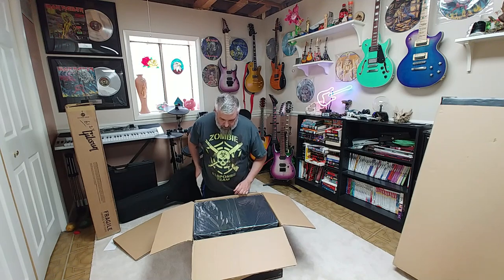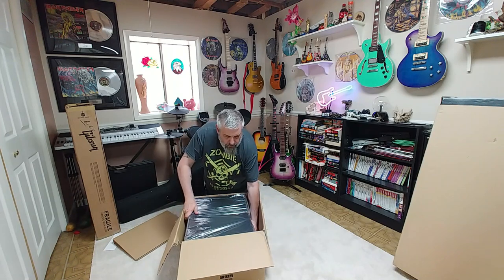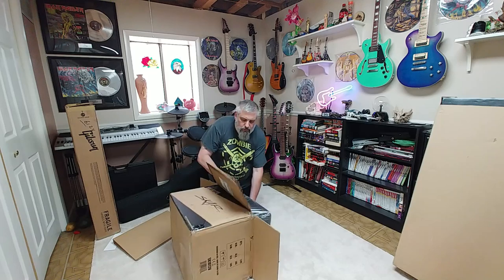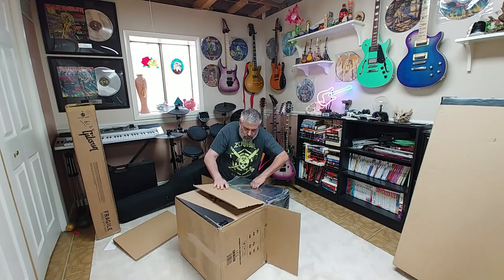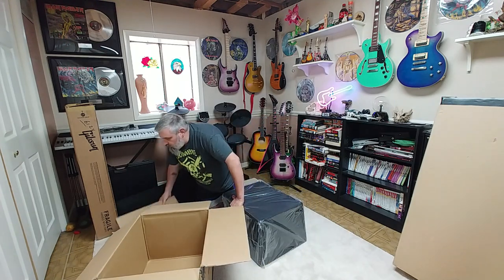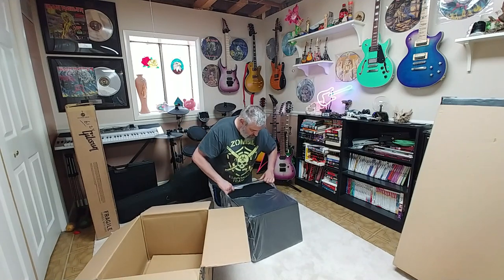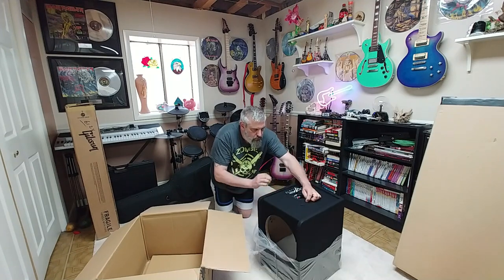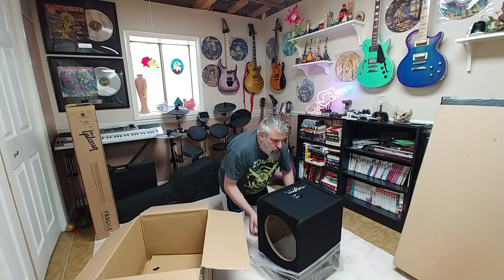Going into the specs of it on their website, I came to find out that the enclosure size wasn't quite right for the subwoofer that I was using. So that's part of the reason why I was missing some of the frequencies, not hitting the right notes with certain music. And once it hit the resonant frequency of the Pioneer enclosure, man, that thing rattled your eyeballs. But it was missing still, and it was missing quite a bit.